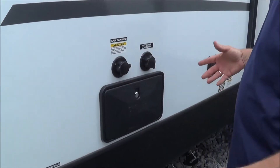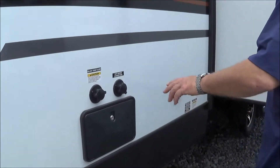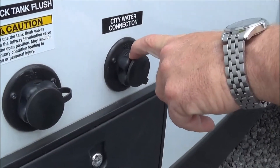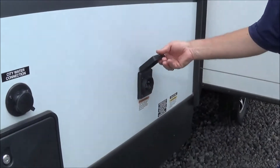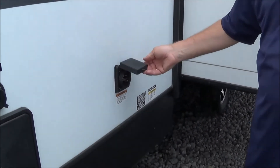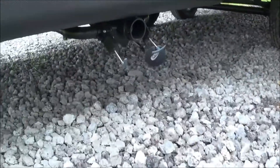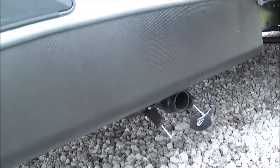Here you have your black tank flush. You just hook your hose up to this, open your black valve, and it's got little sprayers in there so it will clean out your black tank for you so you don't get false readings. Here's your city water connection — just hook your water hose up to that when you get to the campsite. Here you have your 30-amp cord, which is all marine-sealed so you don't have to worry about any animals getting in there. Then down there you can see you have your dump valves — two for your gray and one for the black.